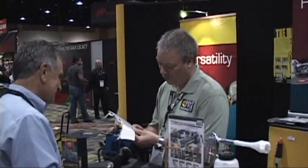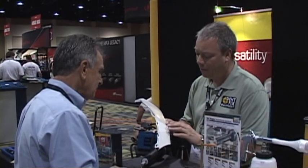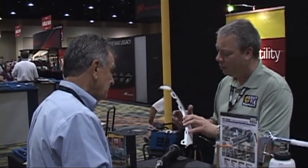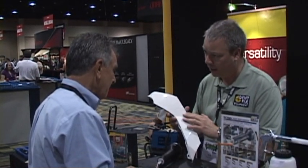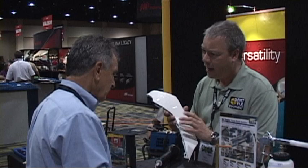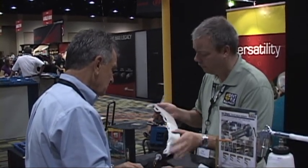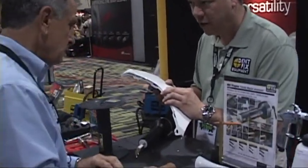When you get in an accident, the first thing that you impact is the bumper in most instances. The bumper is either too badly damaged and gets replaced, or they're repairing it. When they're repairing it, mostly it's a cosmetic repair with either a welder, a plastic welder, and then some material on top. That's not a structural repair, and when they're trying to fit the component back on the vehicle, you'll often have cracking or breaking in the finished repair.